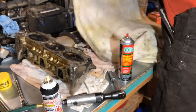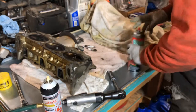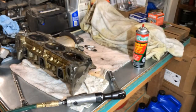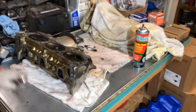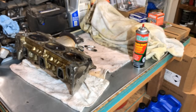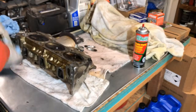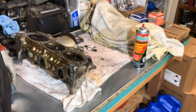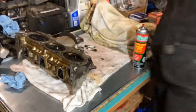man, I'm already thinking I'm going to have to somehow helicoil the threads, which is basically a thread repair. I'll probably be able to walk this thing out, but it was tough to go in before when I put that plug in. So these threads have already been damaged, and it'd be foolish of me to just leave it, because repairing these threads in the vehicle, this is right up against the firewall. Again, this is a 2001 Chevy Venture. I'm going to let that soak in a little bit, guys, because I'm not going to play with this.